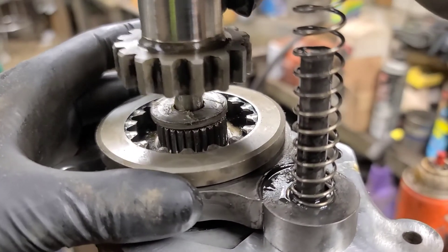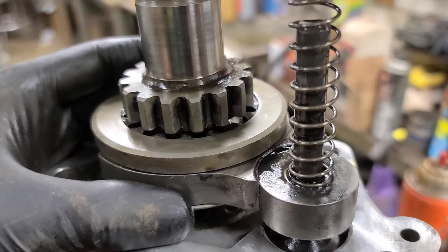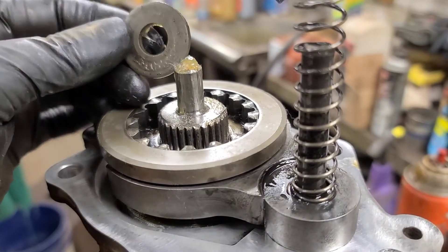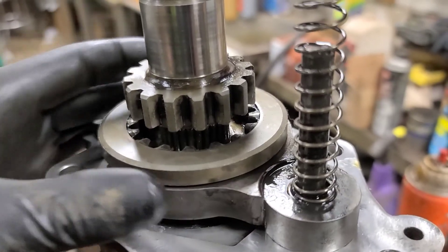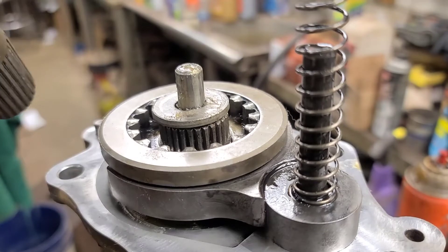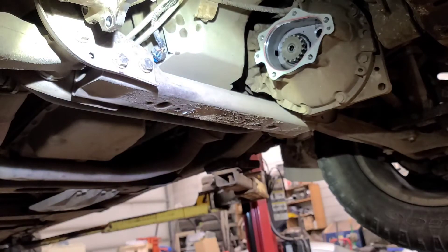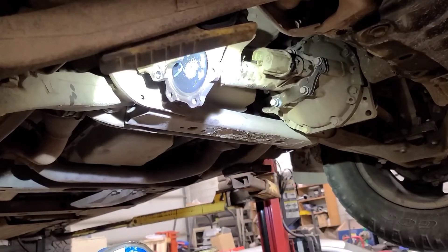There it is reassembled. There's a quite large thrust washer that goes in here - it has to be in there. When this goes into four-wheel lock it catches by about half of that tooth, which seems odd but that's the way it was engineered. The older one used to have a thinner washer in here but this is the way it was engineered. We're going to check end play on this axle shaft when it's in the housing. Got to make sure that washer is on there, put this gear back in - I've checked this needle bearing, it seems good. I'm putting a little bit of grease in it and cleaning up the housing. I have to push this axle shaft up out of the way and then reinsert it - it went in actually pretty easy.